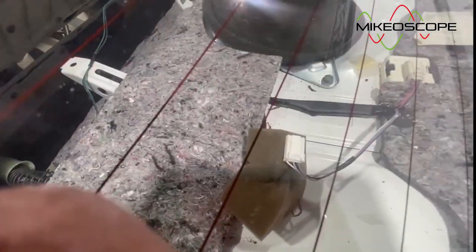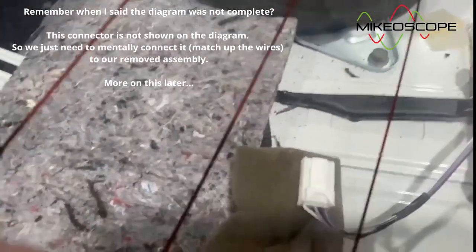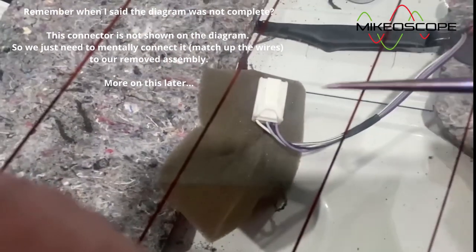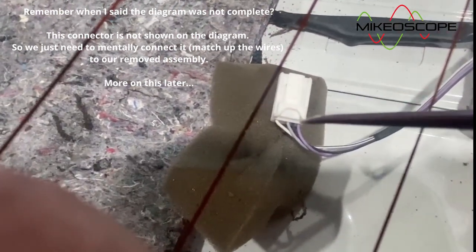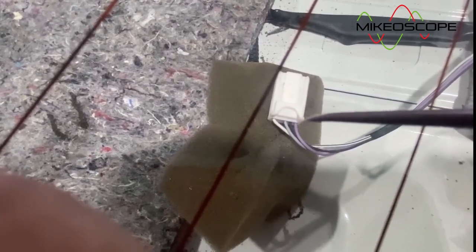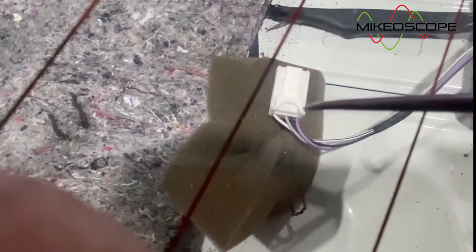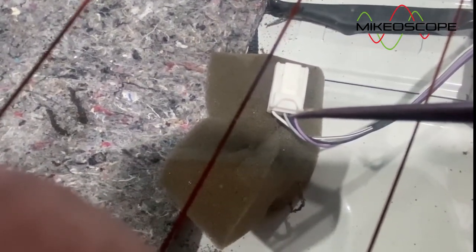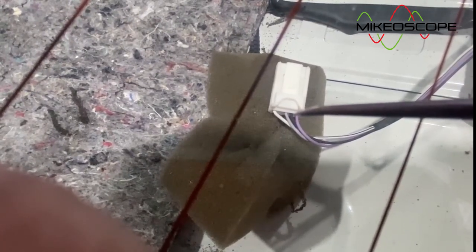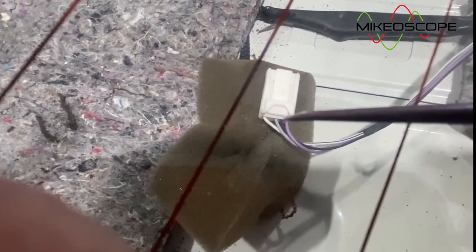Now, guys, before I get in the car, this is the connector I'm talking about right here. So at this connector, I need to be able to check, let's see, this purple pin, right? This purple pin should light when I get in the car and I put my test light on that to a good ground, it should light. And then the black one should light or not based on my reverse gear, when I'm in reverse, okay? And that's going to tell us how that circuit operates.